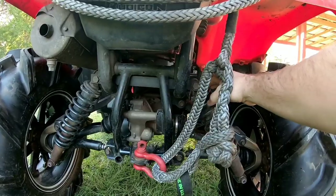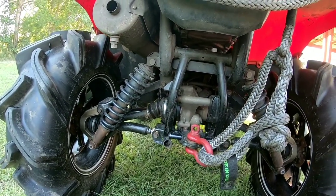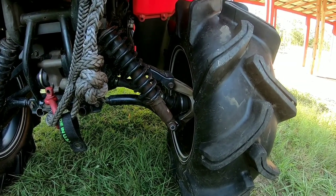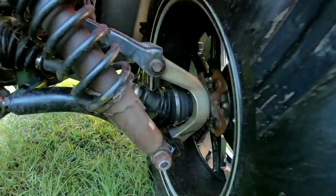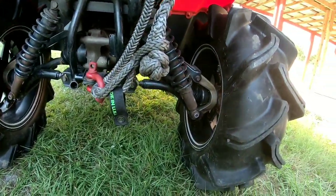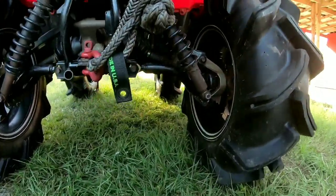It relocates the shock mount in front of your factory mount. In the back of my Rubicon I have the All Balls eight-ball axles. I've had these for a couple months now and no issues. I think they're a better axle than stock, although the stocks did last me a long time. What I noticed over the stocks is the outer cup has a lot more angle ability — it definitely moved more freely with more angle. They're not noticeably bigger than the stocks, despite what their videos claimed.